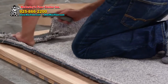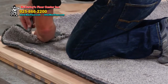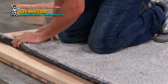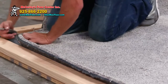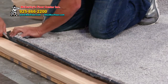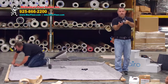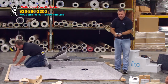The two main focuses with the Aero product are: it needs to lay flat, and the seams have to look good. As Sandin goes around the perimeter, he's simply pulling the liner off and rubbing it down with his hands. For trimming, you can use your razor knife — always being careful not to cut the baseboards — or a conventional wall trimmer. The pad acts like tack strips, jacking the carpet up in the air, so the bottom foot of the trimmer sets directly on the pad and you can push it right around the perimeter.